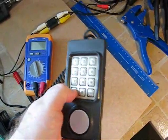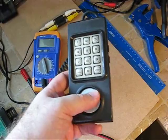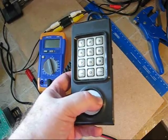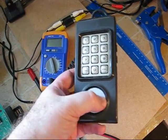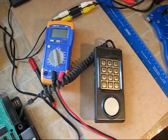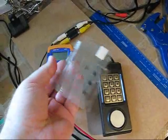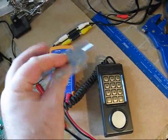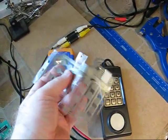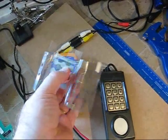The reason these controllers always felt a bit clicky when you press them, and also quite hard to press in the direction you wanted — it's a 16-way controller — as only when I opened up the controller I realised why. The matrix and everything is down to basically these: it's just a printed piece of conductive material put onto acetate. Of course, it's not overly responsive, and with more usage and more presses, the less the conductive material works properly.